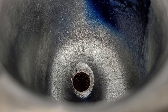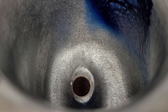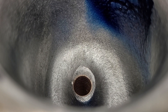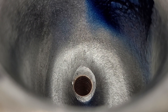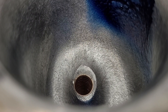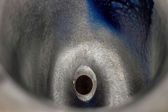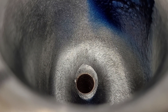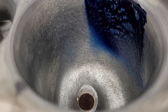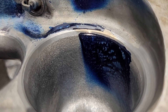I had to machine that down a little bit — if that's not straight, it'll tweak your pilot and skew your whole valve job. So you've got to machine that relatively flat, as flat as you can. I had to touch that; notice I didn't even get to fix that fully, but no big deal — this is a first cut.